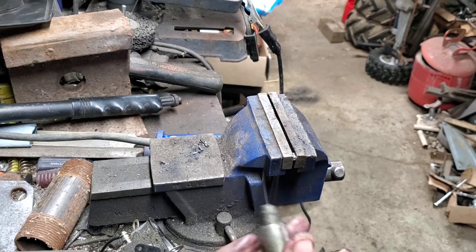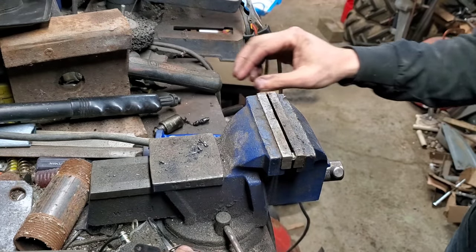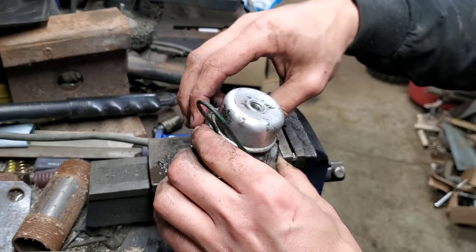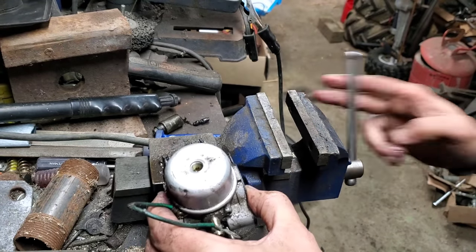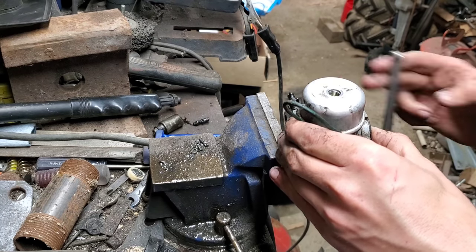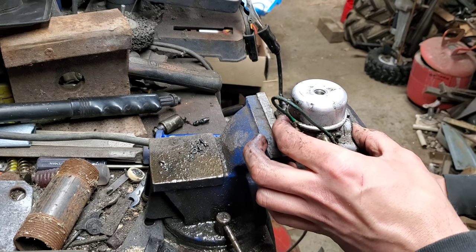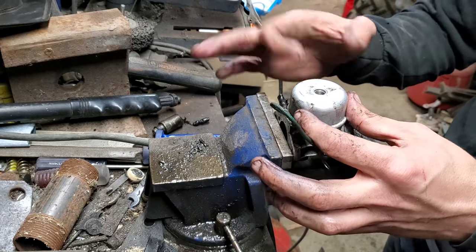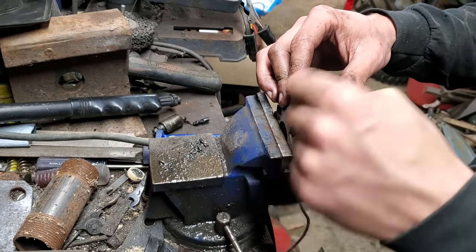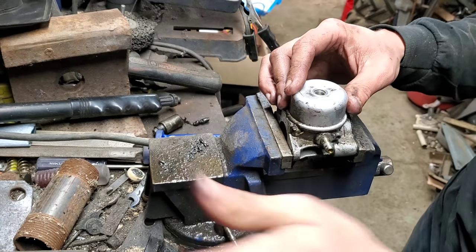Maine approved. So why is the solenoid out? Because on an MTD chassis, some brilliant engineering moron decided it was a good idea to make it so that you have to remove the solenoid valve to get it past the frame rail. So this can go away now — that's our chassis ground — and we'll spin it around, tap it, and get it to come loose.